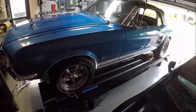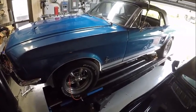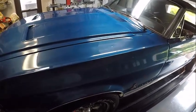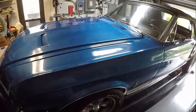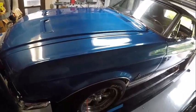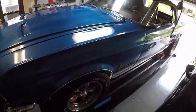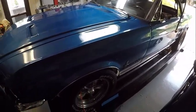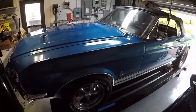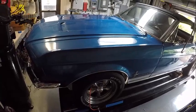In 1967, when Ford introduced this car, they actually specified caster that could be set from negative to a little bit positive. Why would they set negative caster? Because the faster you go with negative caster, the lighter the steering gets — to the point where it's almost scary — and it will not self-center. Back then with manual steering, they had to be able to sell the car to anyone, including people who didn't have the upper arm strength to turn the wheels stationary. So they would set negative caster to lighten the steering. We're going to set positive caster.